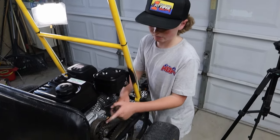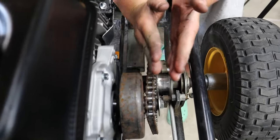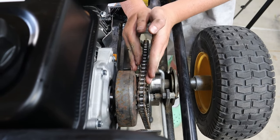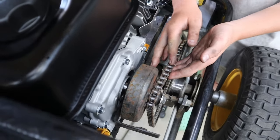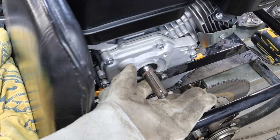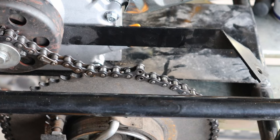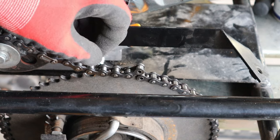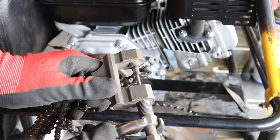So if you see, we have our clutch here and the chain from the other engine — it needs to be perfectly aligned. You can see it's slanted just a little bit, so we're going to try to find a spacer, as that's the easiest way to fix that problem. With this engine being bigger, you can't really move it in and out of those mounting slots, so we're going to have to take out a link from the chain and put in a half link.